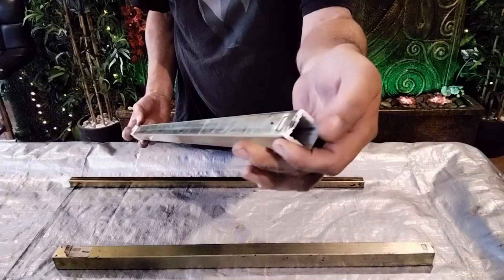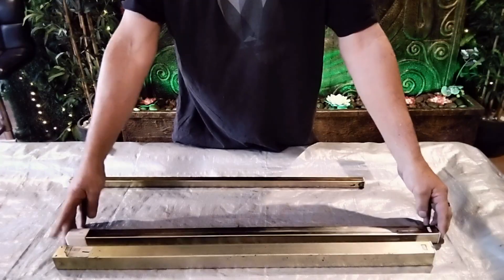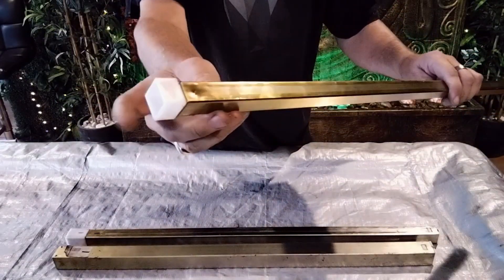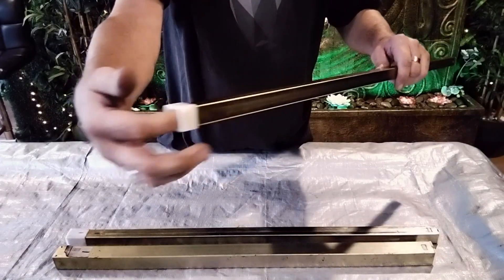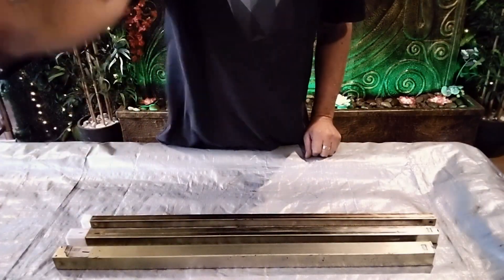At the top that is just the guide which the top center section runs through. This is the top piece again - there's where your bolt goes through that holds onto your roof. This is the bottom piece of that, and you can see there's a little concave section in the middle there where the top of your spring would locate into. This is the bit that the spring actually pushes on to lift your roof.